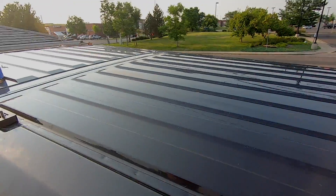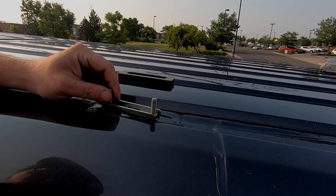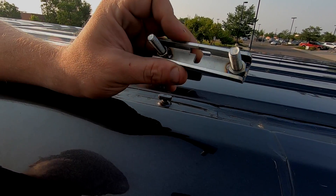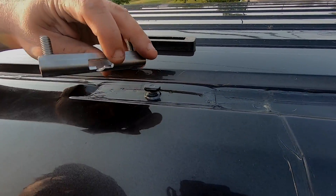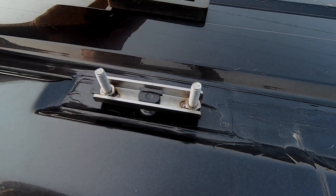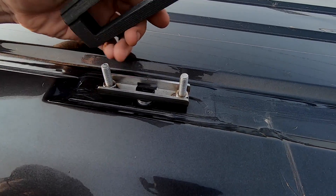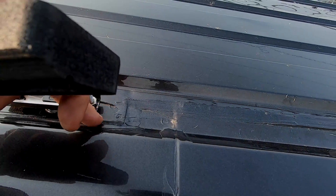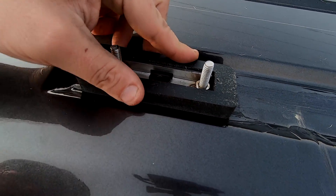As you can see here I have this bracket — there's one up front, and one, and that one, and finally the fourth one. These brackets come from DIYvan.com. Basically how it works is they send you this bracket that's designed to fit on the stock little nubs that come on the roof of the ProMasters. They also CNC'd these plastic spongy pieces so they fit where they belong with the little ribs and gouges on the van, so you put these over the top and they sit nice and flush and don't move around very much.